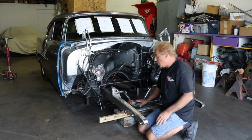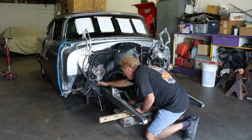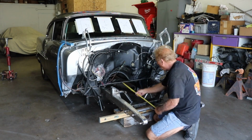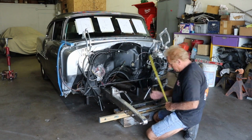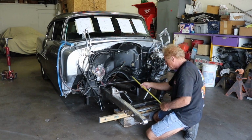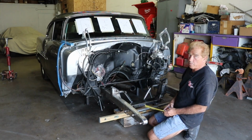The next call out they're calling for is from this brace, which is actually the back of the body mount on both sides. They're calling out a 32.25 right here. And it looks like it's the front edge of this is where they're getting their numbers, because when we're at 4 on these positions, it is 32.25. So that's what they're calling out. That's where we're at right now.